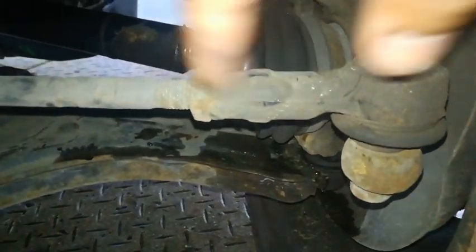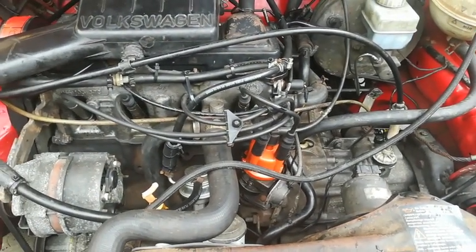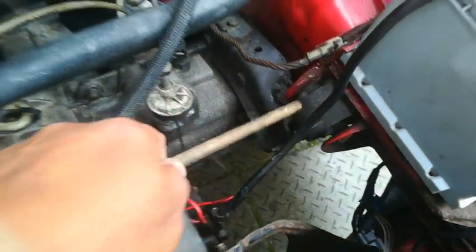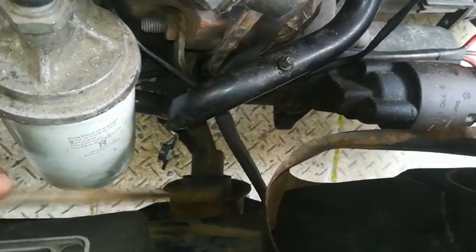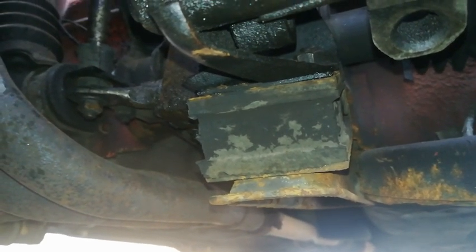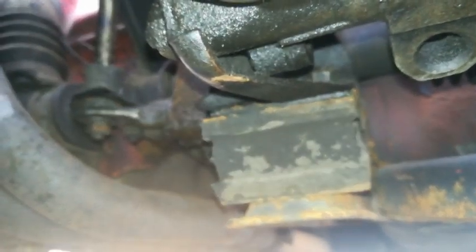There are other things that can also cause vibrations and sounds coming through to the steering wheel — your engine mounts. In the engine you'll find engine mounts: one here just below the battery, another one here, one sitting down here, another one down in the middle, and then another one under the gearbox. Here's a nice view of the engine mount that attaches to the gearbox underneath the car — it's a squeeze-type rubber setup. These things can be checked at the fitment center as they have the proper tools.